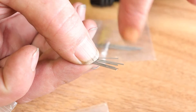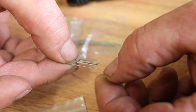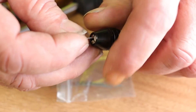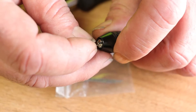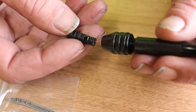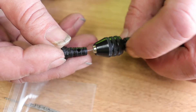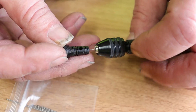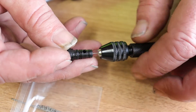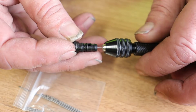The drill set comprises all sorts of sizes, going right down to extremely small. I'm going to grab not the smallest — that's a bit extreme — but about three or four up from the smallest. I'll close the collet on my little hand drill and tighten it up. I'm going to gently feed it through the nozzle and see if I can pick up the jet. I'm feeling quite a bit of resistance there — it is entering into the jet. This jet is blocked, it's a dirty carburetor. This will remove any varnishing or tiny deposits of stale fuel that can get inside the jet and block it up.